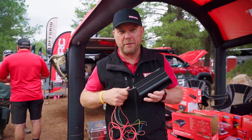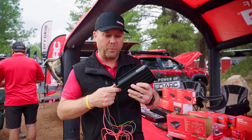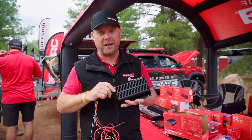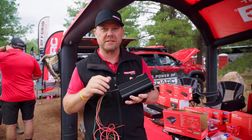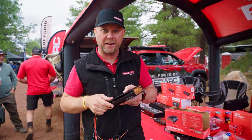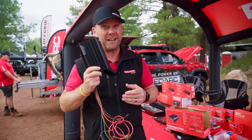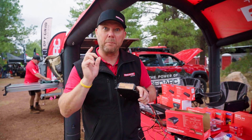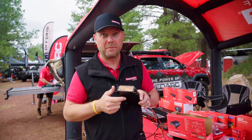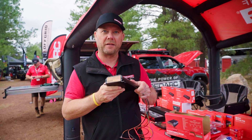It's intended to charge auxiliary batteries from your trailer through your seven-way connector. The way that we do that is we limit the current on the input to a maximum 12 amps, which allows us to charge through your standard seven-way connector. All of the electronics are fully encapsulated in a two-part silicon elastomer, making them water, dust, and vibration proof. These things are tough. You can also select a battery type whether you want AGM, gel, or even lithium. So you might have AGM today but tomorrow you might want to buy lithium batteries — you can program it for lithium as well.